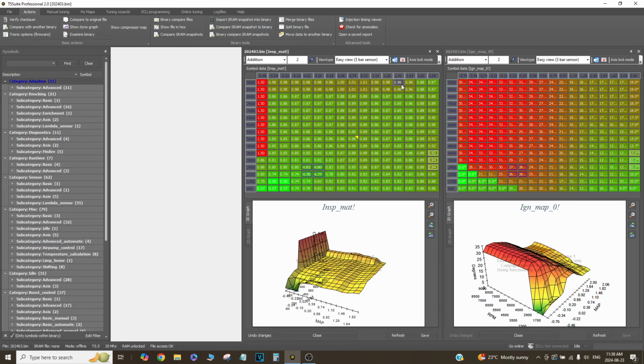So basically I use that switch on the low setting in second gear to mitigate wheel spin, just so the wheel torque is not too high. And then once I grab third gear, then I'm in high boost, and then once I pull fourth, if I feel like it, I get on the overboost button.